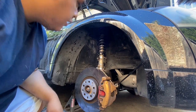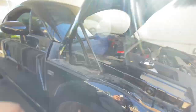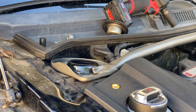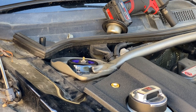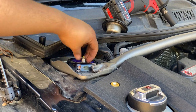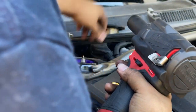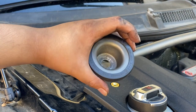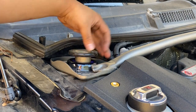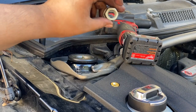Put this up so the strut is in - it's up there now. I'm just gonna lift the jack up from the underside. You guys can see that the nut is exposed, so I'm twisting it on right now. Here's the bushing and here's the dampening setting - just gonna tighten this. Now I'm gonna put this cap on - like I said it just twists on. Cap is installed and I'm gonna put this 21 millimeter nut on top.